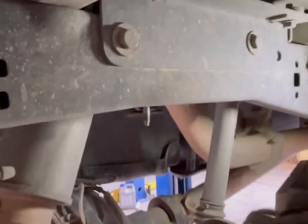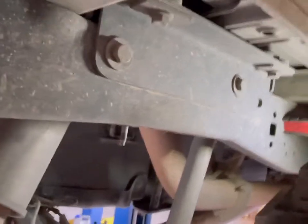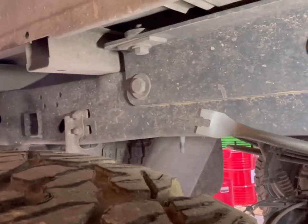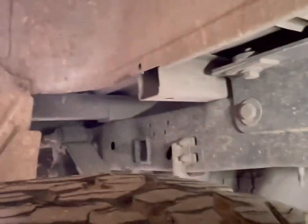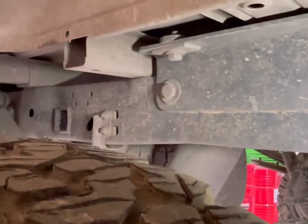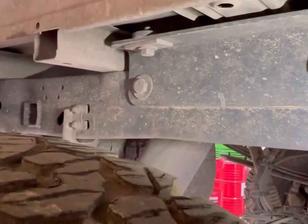All right, here we're starting on the passenger side of this 2018 Powerstroke F250. Take the two 15-millimeter nuts off there. Bracket comes off. You'll pry those two out — I use a little pop rivet tool. Stick it in here, pick it in there, and they just pop right out. Take those out. I'll show you how to mount it afterwards.